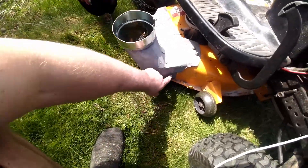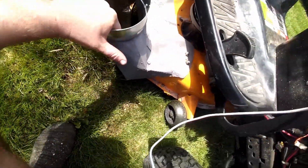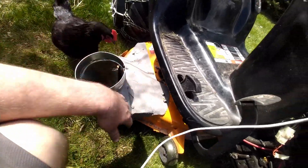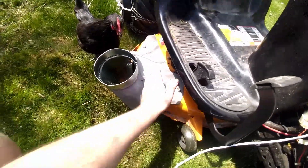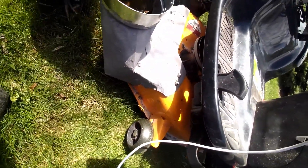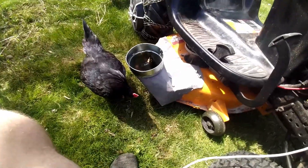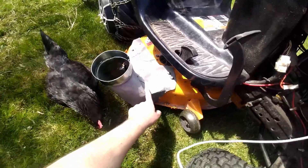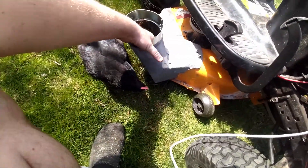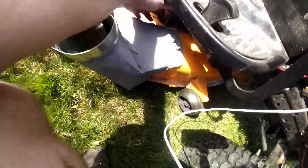If you remove this piece right here, you'd see underneath it's just the boot. I found that bolt hole, marked it out, tapped it with a hammer so I could see where it was, and drilled the hole. I mounted the boot on here, but it was still pretty flimsy on top. Then I cut a piece of sheet metal, screwed it to the boot on the top. It wasn't as trimmed as this — just enough to fit without hitting anything. After screwing those on, I mounted this back on with the one bolt on the inside, then used a soft hammer to pound it down to the right angle.